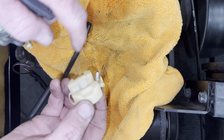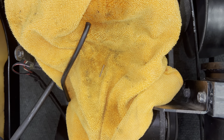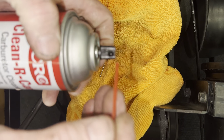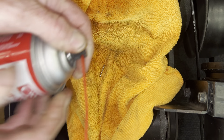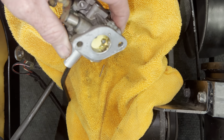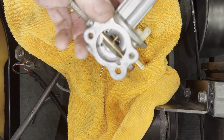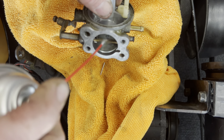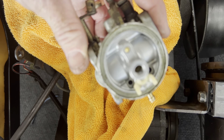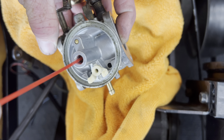What you want to do is take your screwdriver — a big sturdy screwdriver, that little one wasn't doing it. Unscrew it — there we go, got it. Pop it loose and your jet is going to be in there. You have a jet there — this is your low speed jet, this is your high speed jet. Then you want to pull your float pin out, pull the float out, and there's your needle. Just make sure you don't spray any carburetor cleaner on the tip of your needle because it's rubber — you'll deteriorate it. Set it to the side.